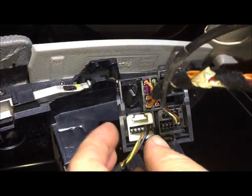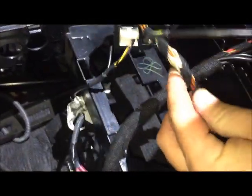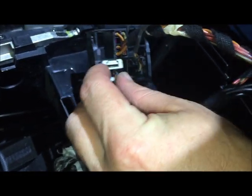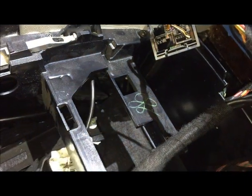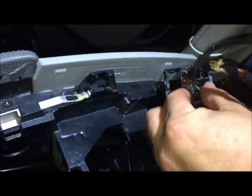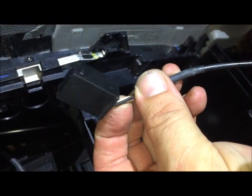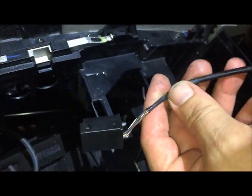Now that we've removed that other section of the harness, we need to prepare the remaining harness in the car to connect to the radio harness — the Avent harness. You're going to remove the two auxiliary microphone connectors: this one is for the microphone, and they had a little remote plug-in. We don't need that anymore. The little black one is the one that is mounted up behind the rear-view mirror — we don't need those anymore. I'm going to use the microphone that's supplied.